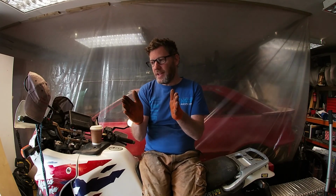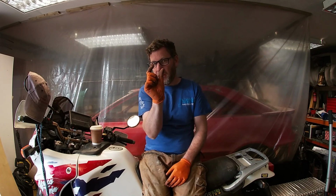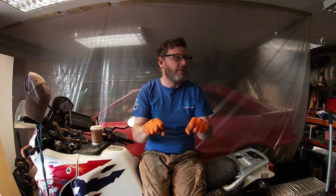Battery box as well. So I was cutting away the old battery box from the Leaf and then test fitting it, getting the clamshell bit on the top, cutting that up, fitting that in, putting it underneath, and it actually fits better than I thought it would. There'll still be a little bit of the spare wheel well. It needs to come back that much, so it'll sit right up in that. But then it's pretty much flush with the bottom of the spare wheel well, which is perfect. I'm going to try and reuse a couple of the main high voltage connectors that came from the Leaf. There's loads of them there, and so that's that.